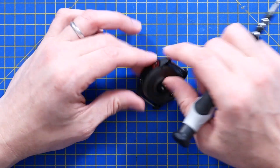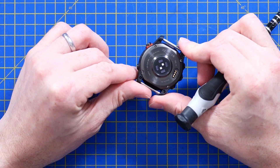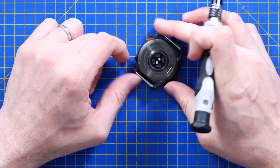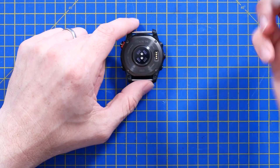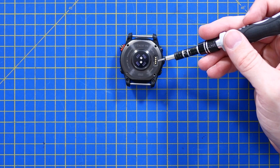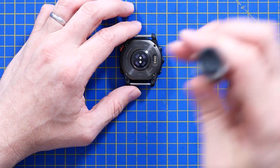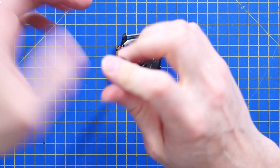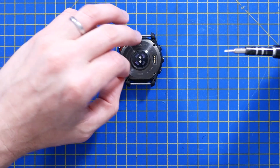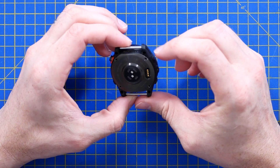It's got a military standard and this is 42 millimeters body size. Although some of this is metal, the plastic bits around the top they describe as a fiber reinforced polymer, which could be GRP, glass reinforced plastic, could be PA6 or PA66. One thing I do like about the design of this watch — the pins are actually recessed here. The little charging port magnetically catches on the back but you actually have to insert that. I had a previous smartwatch where those pins were flush with the back, and general dirt, grime, skin started almost corroding the contacts. So these little pogo pins should be much better protected. But you'd have to be careful that this little bit here doesn't fill up with dirt to prevent charging.